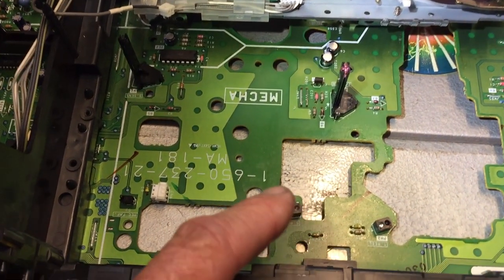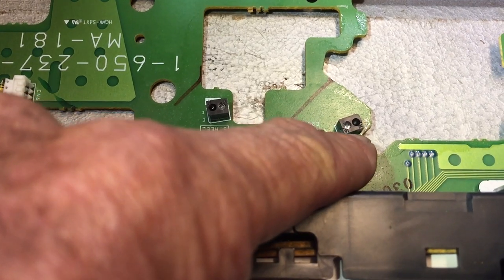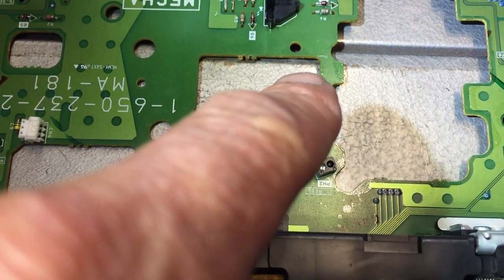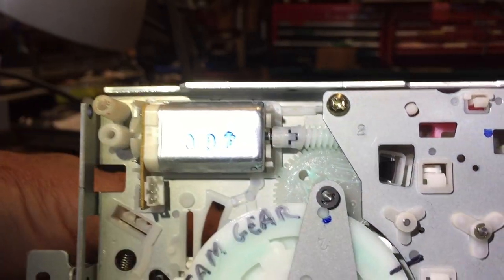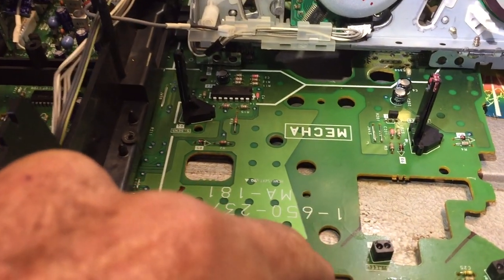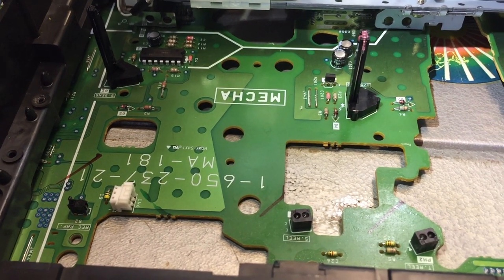The other complaint he had was that the tape counter wasn't working correctly. The tape counter on these machines gets its signal from an infrared sensor and an infrared emitter. On this particular model we've got a couple of them here — one is an infrared LED and the other is a pickup sensor. When the VCR is in the run position, you've got this beam shooting upward into a port on the cassette deck that has a chrome reflective surface, part of which is painted black. As it rotates, the infrared light hits the chrome reflective surface, gets reflected back down, and is picked up by the sensor — and that tells the counter what part of the tape you're in.